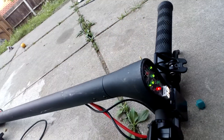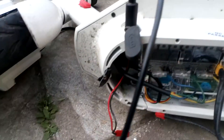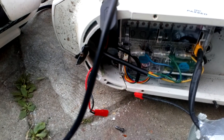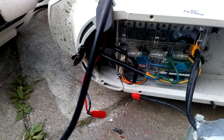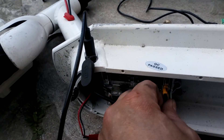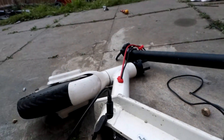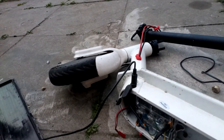This is why on those scooters you need to actually move the wheel. As soon as I do that — error four in this case. On some websites it says error four is a throttle error. Depends on the scooter you have. In this case I'm 99.999% sure it's a controller error, because if I unplug this, then power it off, power it back up again, and then try and run it on two phases — two wires plugged in — just pass the throttle again.